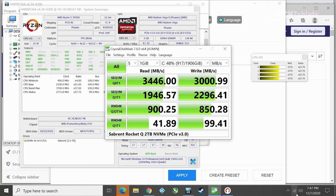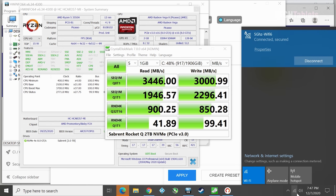The wireless card and antennas are working well. To get the maximum benefit from the AX200 card for future-proofing, you do need a Wi-Fi 6 router - which are expensive and most people still have Wi-Fi AC. Even so, the reception is really good - so much better than before. I'm getting transfer speeds of about 1.2 to 1.3 gigabits, which is faster than the gigabit LAN on this unit. Really good wireless - very happy with that change.